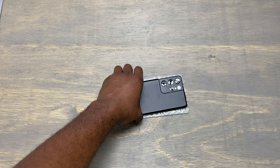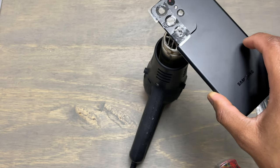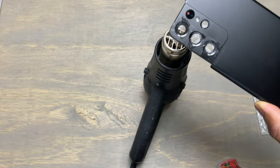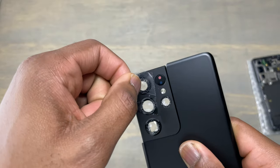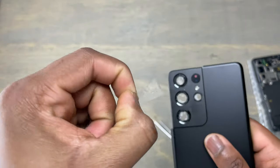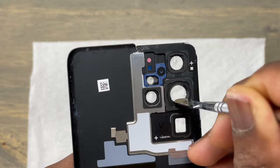For the back cover removal, I added a link into the description. You will need to remove the back cover of this device in order to replace the lenses. The danger of having the lenses broken is that they can stop your camera stability, and also in the long run, you will have dust and particles of glass on the sensor of those cameras.